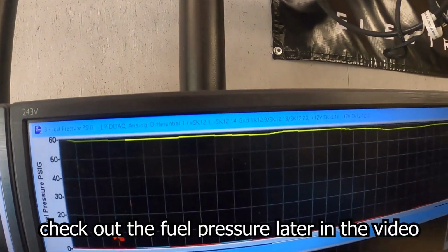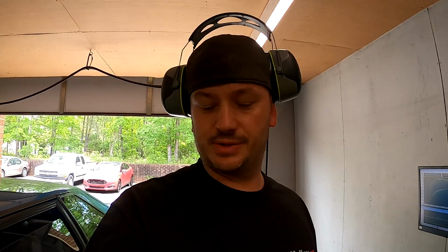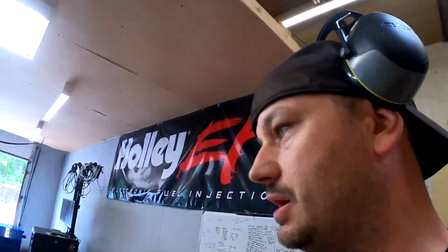Got two things that are a little bit interesting here. First, fuel pressure actually maintained pretty well, so maybe it just wants that much fuel in the VE table. Seems a little bit weird, but I've seen weirder. But the other thing is, when it's doing the weird shutting off and the stuff associated with that when it acts goofy, like I was saying, how it drops communication with the computer, and everything freaks out and starts running weird, as it's doing that, the fuel pressure is fluctuating like 40 psi. So there's definitely something weird going on with this, and I'm not sure. That might be a kind of a homework project for the owner of the car to go through that stuff. This thing has like 100 grounds on it too.